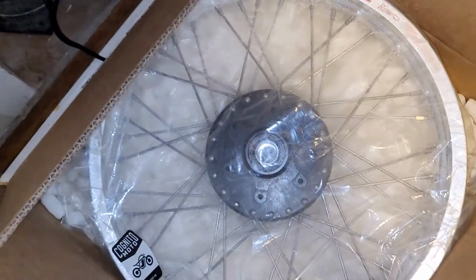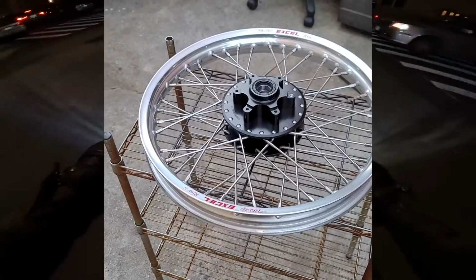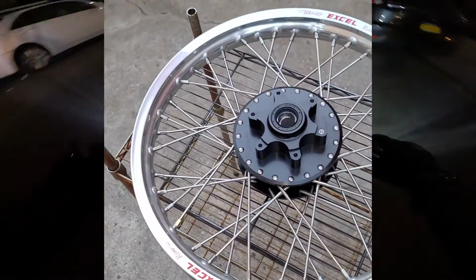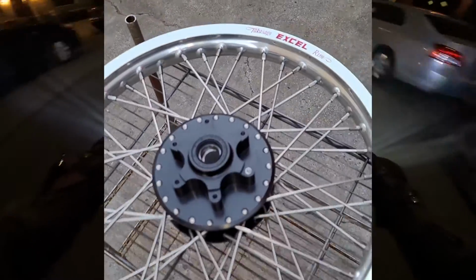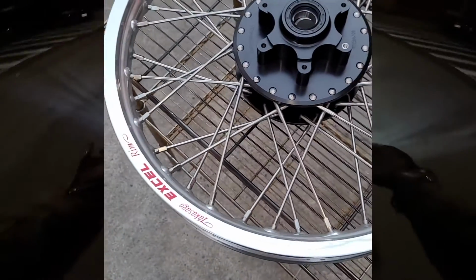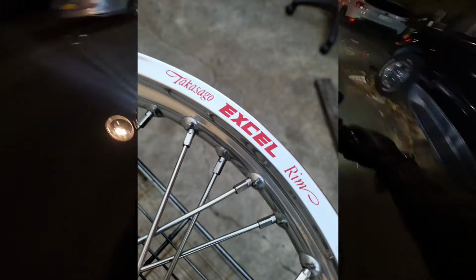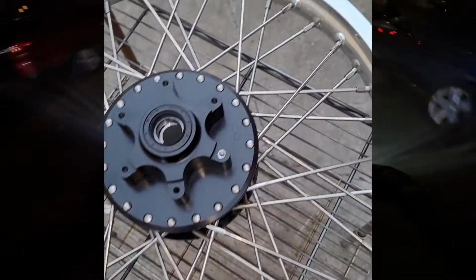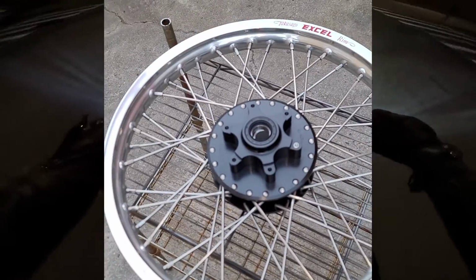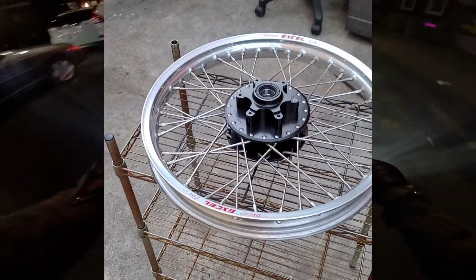So I was happy to finally get it, but it took like a month. I'd also finally gotten that custom-made 19-inch spoked wheel that emulates the stock wheel size but can be bolted onto a modern CBR front end. I ordered this a long time ago from Cognito Moto. The reason why I'm not making a huge deal out of this rather lovely wheel is that I ordered it on October 1st and it arrived at the end of November. By that point, I had concluded that it would take too much modification to fit. I realized that I would need a new triple tree with more offset for the wheel to clear the exhaust headers under suspension load. The wheel is not specific to a 550, it's just specific to modern CBR forks. So with that said, I could use this on a future bike.